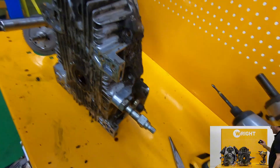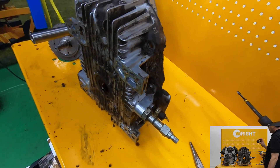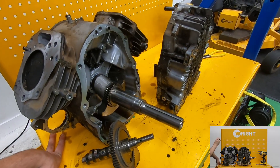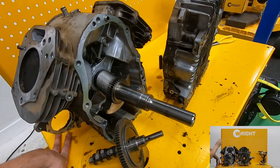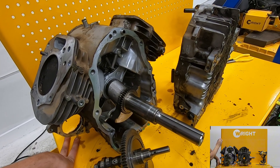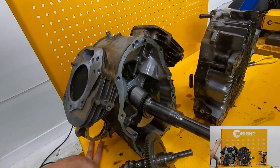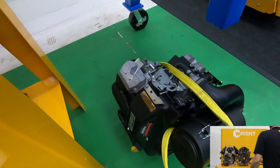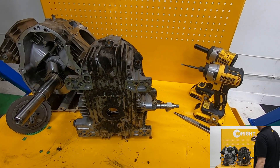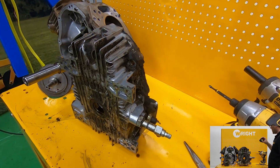So that's a roundup on the Evo engine: it's more powerful, more efficient, easier to service, easier to get at. You're going to have to make your own decision about the engine choice you like — I'd obviously take your dealer's advice very seriously because they'll have the most current information around support, service, parts, and any particular things going on with the engine in a given application. But what I wanted to do here is give you a sense of what this Evo engine is, what makes it different than an FX850. It's basically the same engine, but EFI-only with higher-performance heads and cooling enhancements. Hopefully that's helpful to you as you look at your engine choices this upcoming spring.